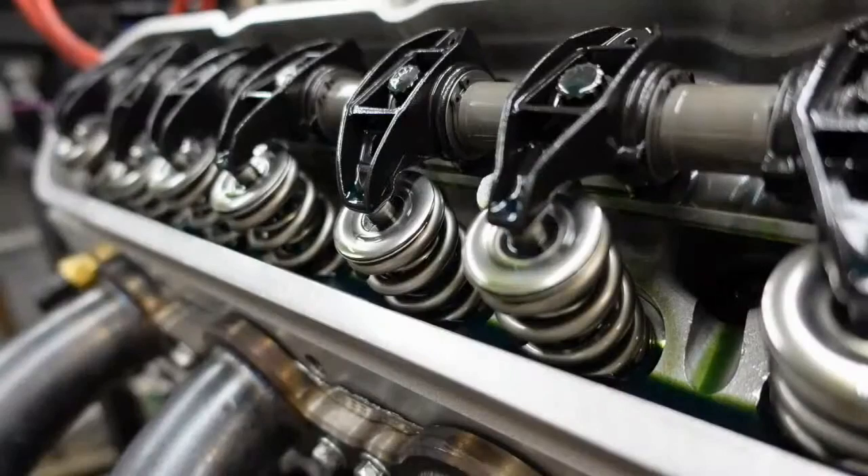We were floating at 8,100 RPM. So what we thought was, the rocker system isn't stiff enough. So we went to CompCams and got one of their new BSR shaft mount rocker systems.